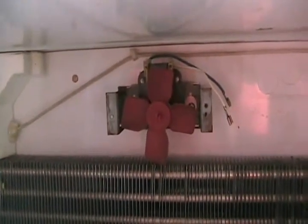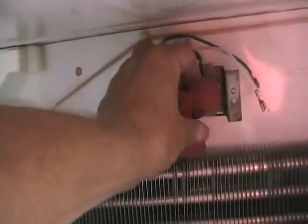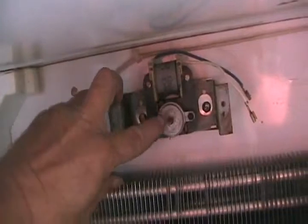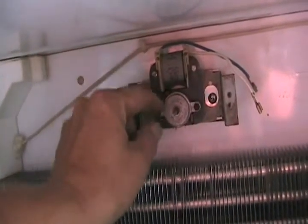Sometimes it actually just seizes up and doesn't make a sound. Sometimes it starts hitting ice from a defrosting problem, and the ice stops it from turning. Most fan motors you can just pull on the fan carefully by grabbing it in the middle and they slide right off. You check for side play on the little shaft — you shouldn't have any. It'd be wise to oil them. Automatic transmission oil, or a really light non-detergent like 3-in-1 oil or sewing machine oil works the best. They have a bearing at the front and a bearing at the back. There's a felt-type material around the bearings which absorbs oil — put lots of oil in those felt things, make sure the motor is turning freely, put it back together, and your fridge might work for years again with the same old motor.